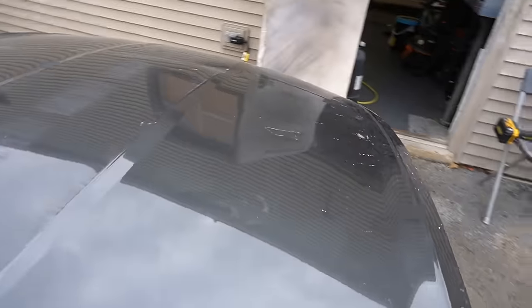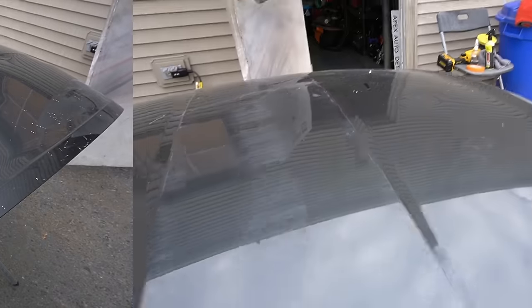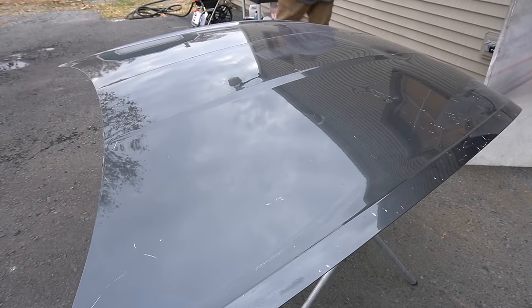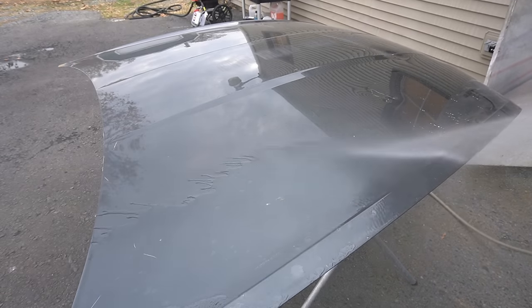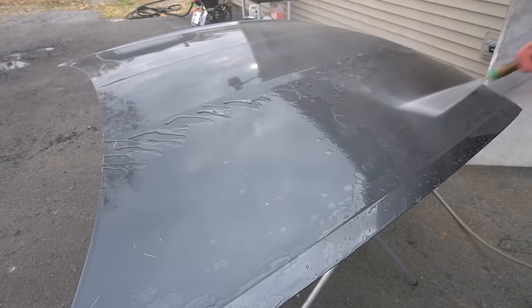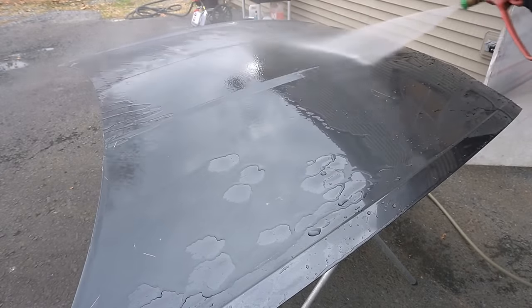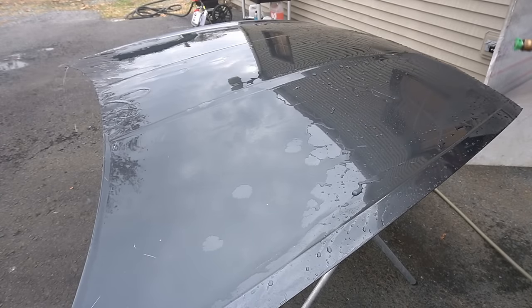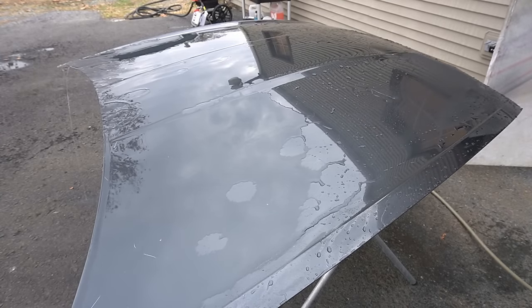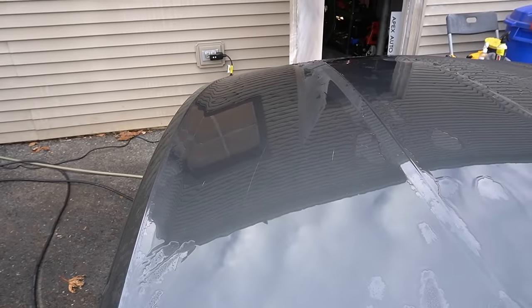The test panel is darker so it's easier to see. When applying this coating, you want to do proper prep to get the most out of it and reach that five years and go beyond. Because it is a five-year-plus coating, prep and maintenance are very important. That means wash, full decon, iron remover, clay, and polish — even if it's just a cleaner polish or one of those primer polishes. Keep your eyes open on the site; there may be one coming from the Blue Collar line.